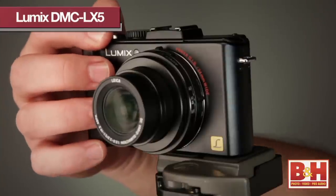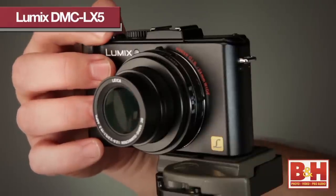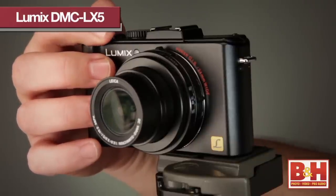By using the f/2 lens on the LX5, you can take pictures at a higher shutter speed, capturing crisp, clear, blur-free images in lower lighting conditions. Cameras in low-light scenarios can produce blurry images due to image shake at the press of the shutter. Panasonic introduced Mega OIS — optical image stabilization — which is their system for correcting vibration when the shutter clicks.